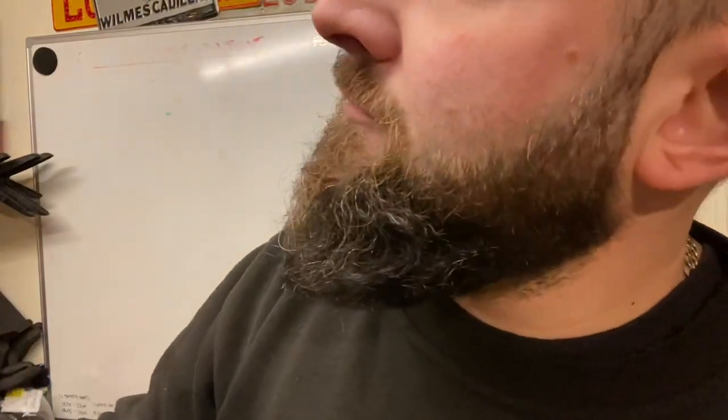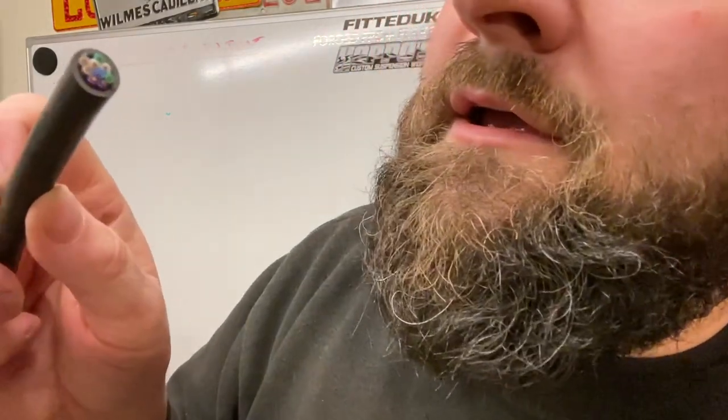So I always like to start by getting my switch wire. This is 9 core, but we're only going to use 7 of the cores. You need enough cores for the dumps and the solenoids that you're going to be running. So in this instance, it's 2 pumps. There's going to be 2 banks of solenoids and there's going to be 4 dumps. So you need 6 wires to power your dumps and your solenoids. And then of course you need your 1 12-volt main. That's so when you power the solenoid, you've got 1 wire for that 1 bank of solenoids and you've got 1 wire for the dump on that pump.